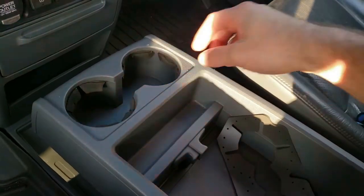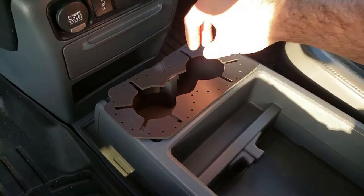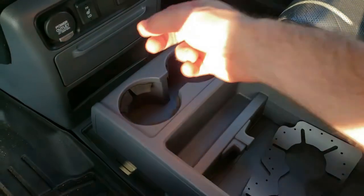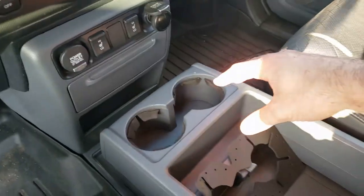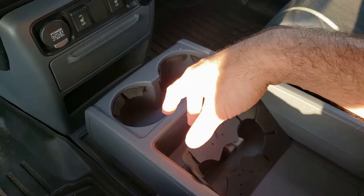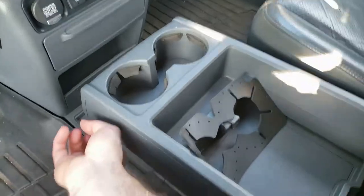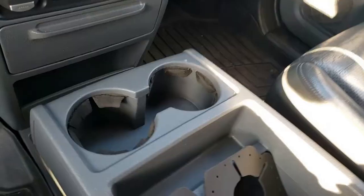This cup holder has a piece of foam — an insert that goes in there with little tabs that hold your cup firmly inside the larger cup holder. This is a very common problem in every Ridgeline I've seen, and it's easy enough to get a cheap part. I think this is $11 on Amazon. A couple videos said to take off the entire console, but somebody else suggested there's actually just five screws underneath. I'm going to test that method and hope it is that easy — just get those five screws and replace the foam.